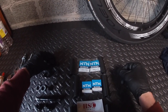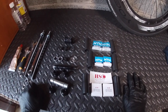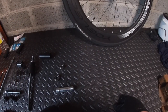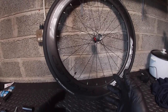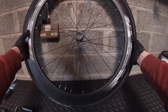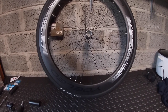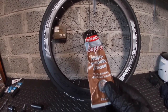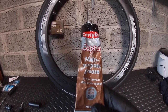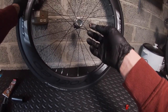So we're all good — I think we should do the front wheel first. I've just cleaned the axle up with some meths, and did the same for the hub. What I'm going to do now is just put in some anti-seize, just because I like anti-seize. If I'm ever going to get anything out of anywhere — yeah, that's the one I use. So if it ever needs to come back out, I'm putting anti-seize in there.